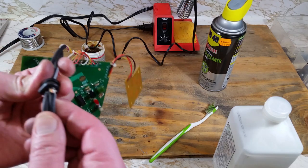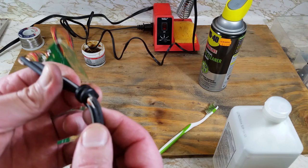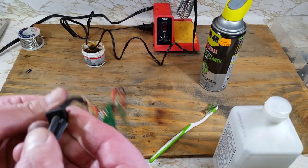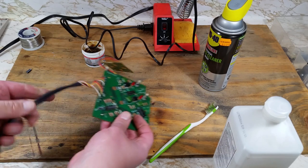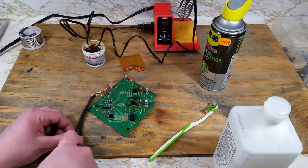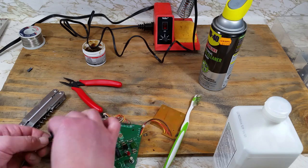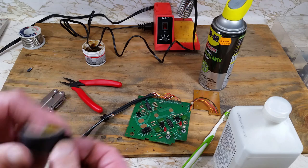On to working on that cord. Looking closer I still don't see any wires that broke, just the insulation. So I think what I'm going to do is just remove that rubber piece and move it down the cord a little bit, hiding the broken part inside the controller. Looks like we're going to have to cut it off. Being careful not to cut ourselves or into that already broken cord. Careful again to remove it without ruining it worse than we already have, then we'll just replace it further down the cord. We'll wrap that cord up with a little bit of electrical tape, just for safe measures.